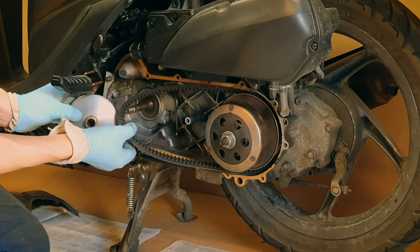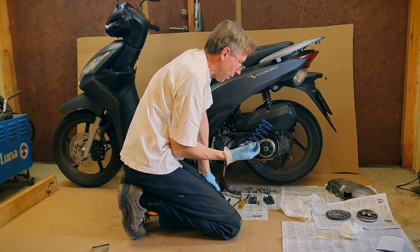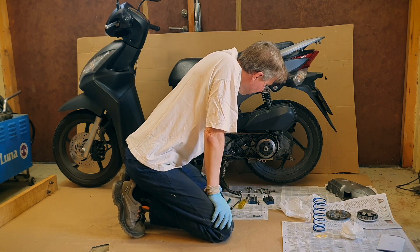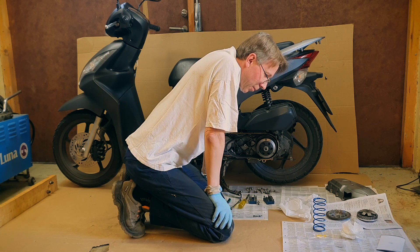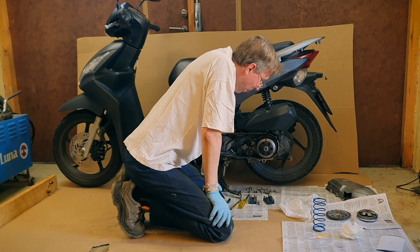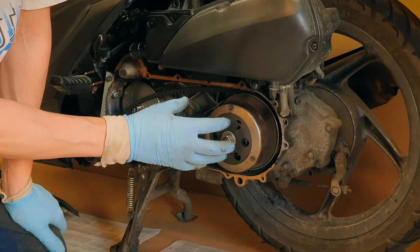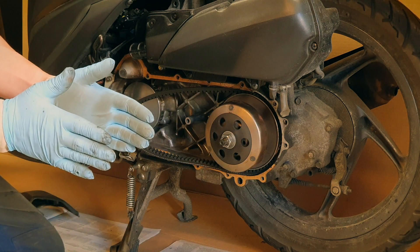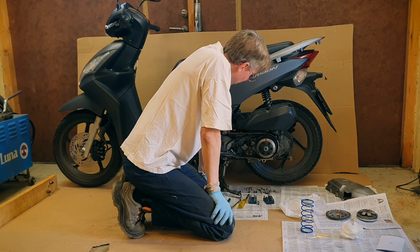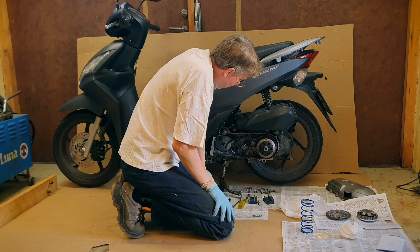For some reason they have included a set of springs for the clutch. Polini seems to have the opinion that you should change the way this grips. If it's a lighter spring, it makes it easier for the discs to go apart — maybe that's the theory. One would like the outer diameter to be big and the inner one to be small. Now I have to take this thing apart somehow.